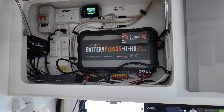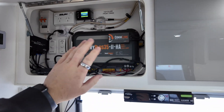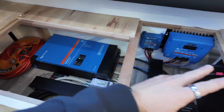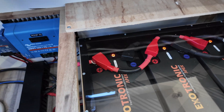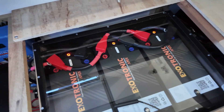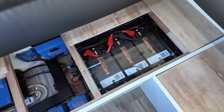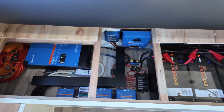The BM Pro battery plus hub now is basically just like a big fuse panel — it's doing no charging at all, no DC charging, no solar, no AC charging. Your multi-plus here is doing your AC charging and your inverting, running all your power points at 240 volts off your battery system. You've got one, two, three solar controllers and then a fourth doing your DC charge. We've run 70 mil cable across all batteries, taking the active off the first battery and the negative off the last battery to make sure they all stay balanced. All of them were charged to full, balanced, put in here, lid on and sealed. The Perspex lid is a good little touch so you can actually see what's going on in there.